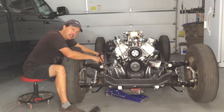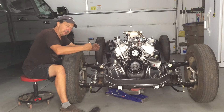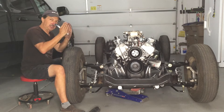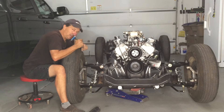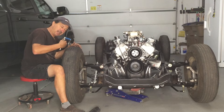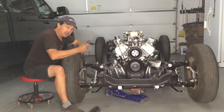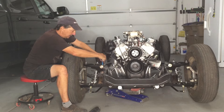There are two bolts on the top of this. As I move one bolt, it's going to change the direction of the A-arm and the position of the spindle. I want this spindle to lean back a little bit. So since I have to bring this tire out, if I take and loosen up this bolt and bring it out this way, it'll drop the spindle back. So I'll start with that, and maybe I can get both of them adjusted at the same time.